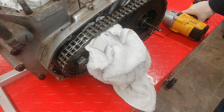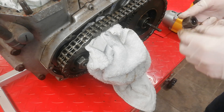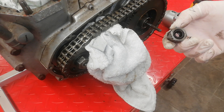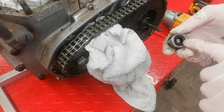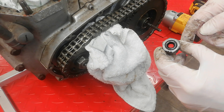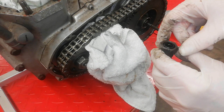I should have protected this thread — covered it to avoid damage to the oil seal, but I'm going to replace it anyway. There's a small oil seal in here, and looking at it, it's been fitted the wrong way around — inside out. The purpose of this oil seal is to stop oil going down the clutch shaft pull rod into the clutch. You always want the open side facing the oil, so the open side should be facing outwards. They've fitted it inwards, so that oil seal wouldn't be doing much.